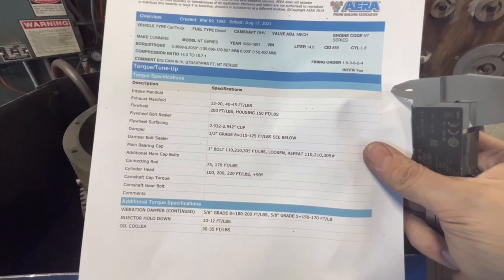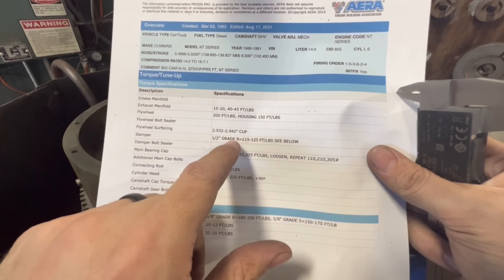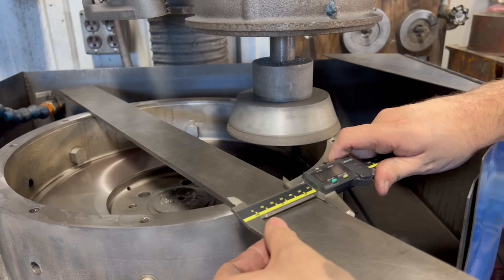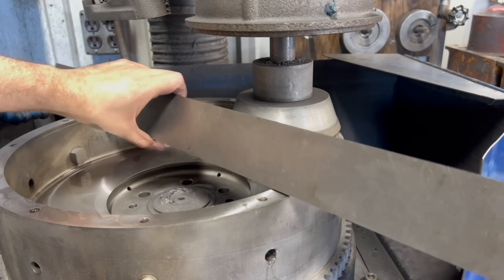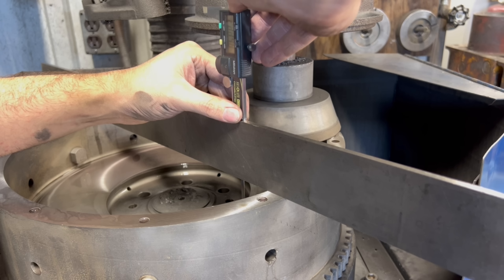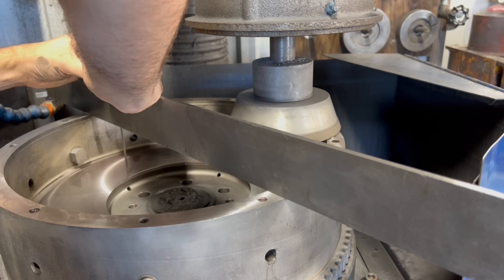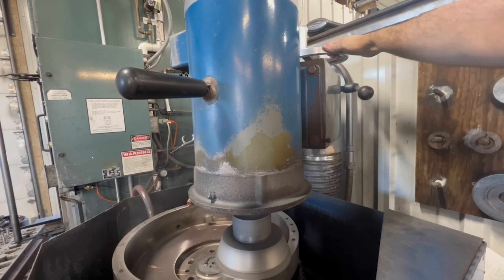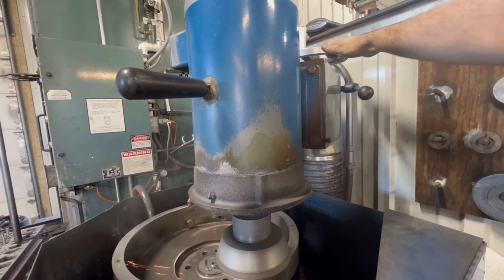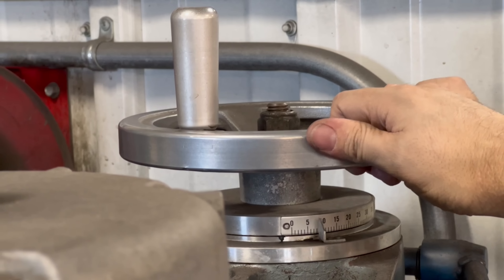The guys who have been around a while will know that the specification between the steps is going to be 2.937 inches right off the top of their head, but I went ahead and printed the specification sheet to show in the video. We can see that the spec is allowed to be from 2.932 inches to 2.942 inches, giving us a tolerance range of 10 thousandths of an inch. An easy way to make this measurement is to take a precision ground straight edge and lay it across the top of the flywheel. With our caliper zeroed to the width of the straight edge we can then make our depth measurement from the top of the straight edge to the bottom surface — this looks complicated but with practice produces very accurate and repeatable measurements.